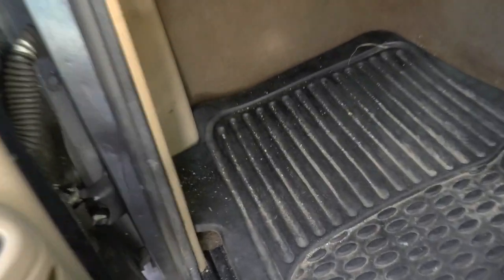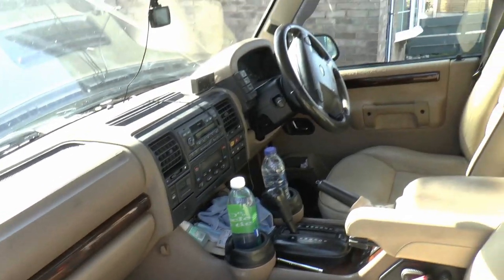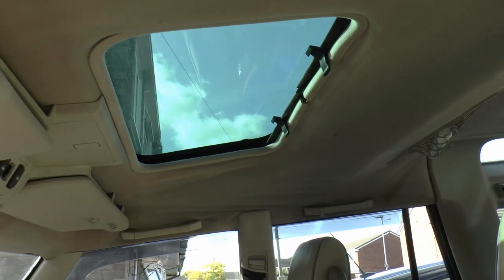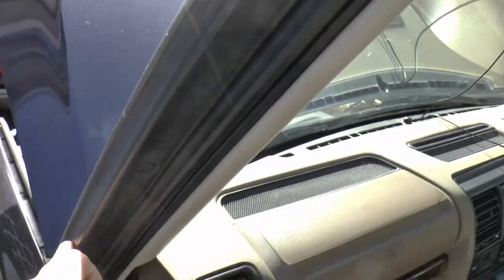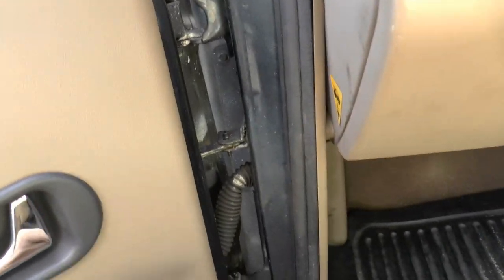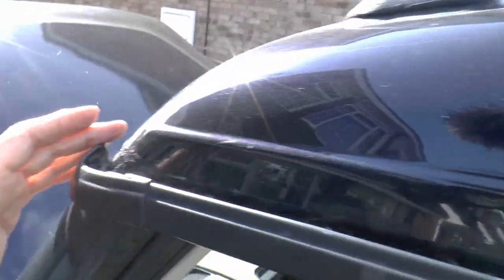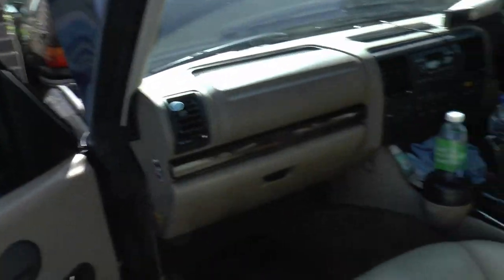This side — dry carpets, because we've sussed out where the leaks were coming from. Where isn't it coming from? We know it comes from the sunroofs, from the sealant itself, from the drain packs, from the big plastic thing that falls off, from between the cover on the metal bit where it scoops up and goes down the A-pillar into the bottom. We know if there's a hole where the check strap is, water can get in there. And of course, from the top of the windscreen — that was an official Land Rover fix.